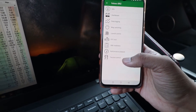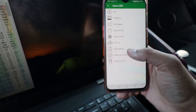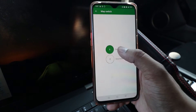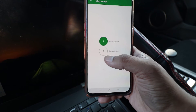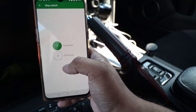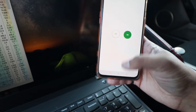Launch Control is already set to 4000 RPM and you can change that to whatever you want — we'll experiment with that. For map switching, I asked Zach to put my standard tune on one map and a more aggressive race-style tune on the other with launch control enabled, auto rev matching enabled, and traction control I think disabled. Those are all toggles you can add to your dashboard, and traction control is on by default.